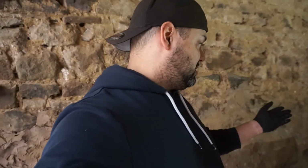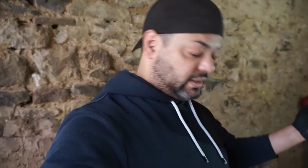So I said, let me try to hone it. Like I said, cylinder 4, my nail was getting caught. I was like, we got scratches, dents, we got everything in there. I guess I was thinking the cylinder walls had rusted out, but that wasn't the case. I honed it out, and everything came off, and now we're gonna look at it.